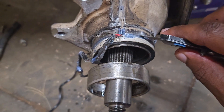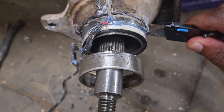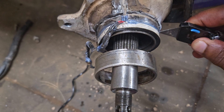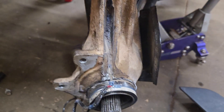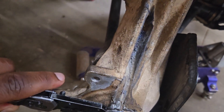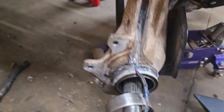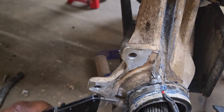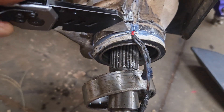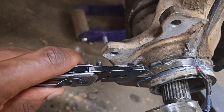Take a knife and angle it just a little away from the coil and work your way behind here like that, because it has glue on it. We're replacing this — we've already determined it's bad. The way you determine yours is bad: there may be magnetism, but if it's weak and you can easily spin that plate on there, then it's bad. It's supposed to be very strong. Work your way down — that glue is pretty strong.